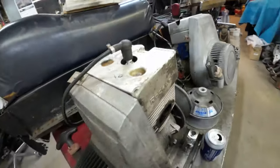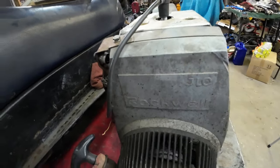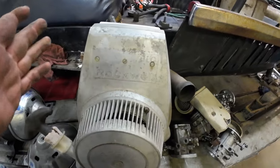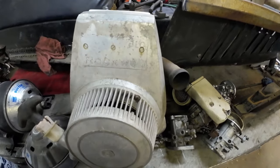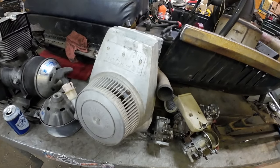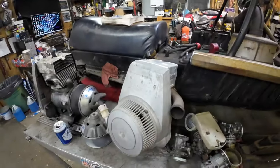Another way to tell it isn't just an R head on an L is these screws right here — the L completely lacks those screws. There's some kind of baffle in here for the cooling. The fan is different; it's got a lighter flywheel and no provision for electric start — when they say that, they mean there's no ring gear on the flywheel, to give it a lighter flywheel. I've been told there are porting differences and that the head gives it higher compression. I'd buy all that — we're talking five extra horsepower out of a 300cc single, which is a lot.